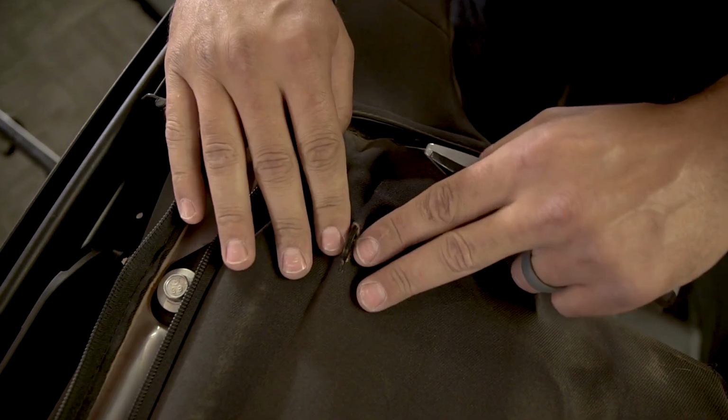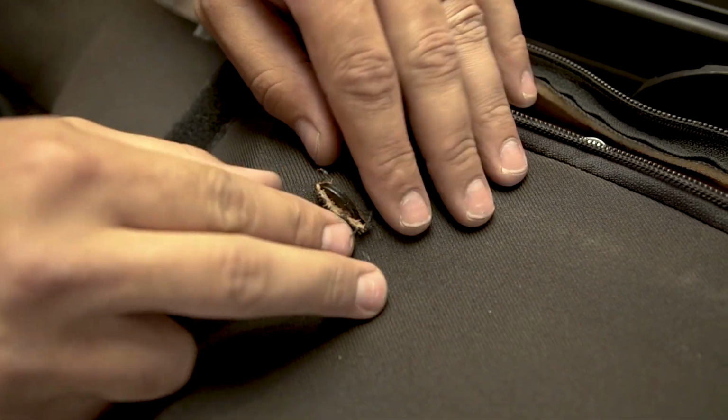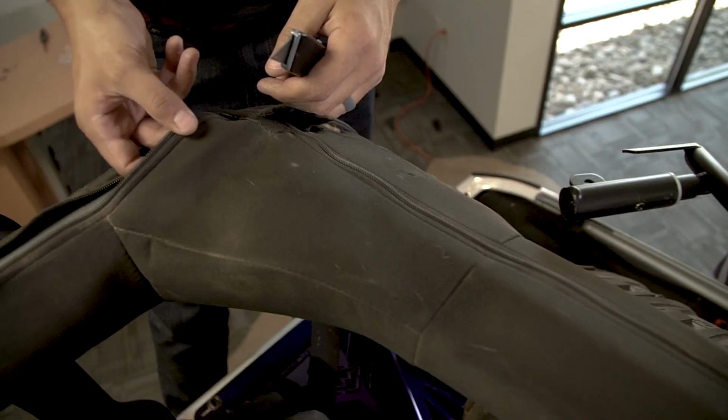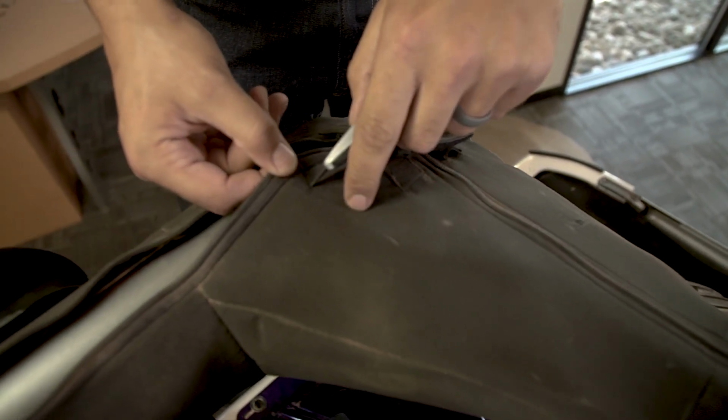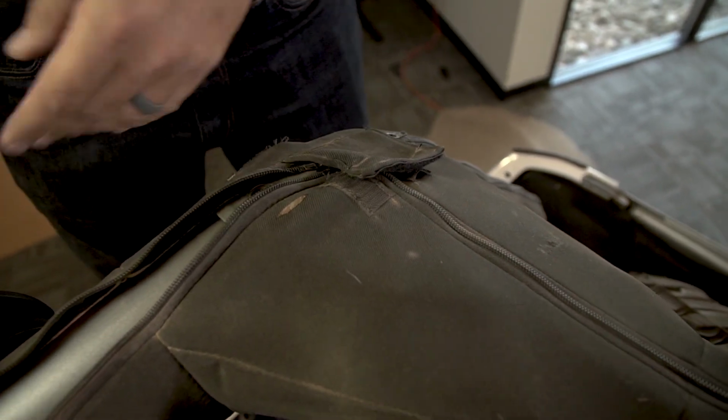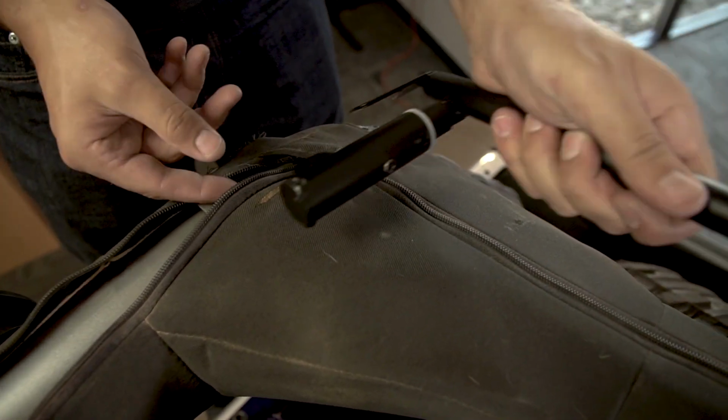Locate the vertical tab on the number 2 bow pivot bracket and slit the sport bar cover to allow this tab to protrude from the cover. Unzip the sport bar cover over the rear crossbar to expose the sport bar corner plates and the factory installed hex head bolts on each side. Remove these bolts.